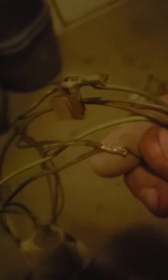These are just some sort of wire holder that slips onto the sheet metal through the hole just behind the light assembly and the bed. Basically the only repairs are on both sides. I'm going to add the sheet metal ground when I redo the ground splice — even though the existing splice looks good I'm going to redo it properly, do a better job of soldering, and then add that fourth lead to provide an additional ground on the passenger side.